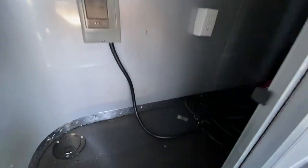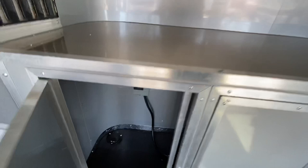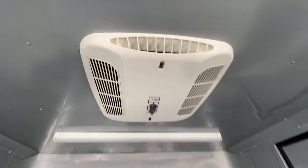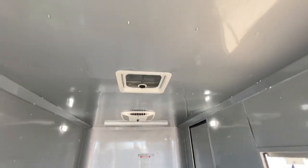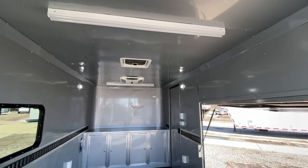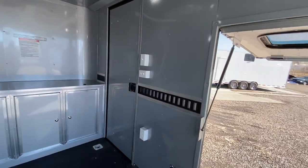This is also equipped with power — you can see the outlets here. You've got your 30-amp box right here. You take the big long cord, pop it through the cord port, run it to your generator on the tongue, and that brings 110 power into the trailer, powering up those outlets. It's going to run your AC unit with a heat strip — you can see you have hot and cold — and it's going to run your two big four-foot LED lights across the ceiling, so you'll have a ton of light in here for working on something or camping.